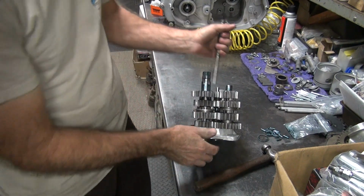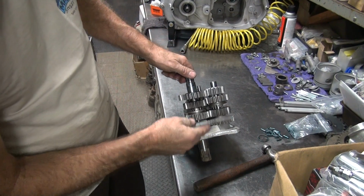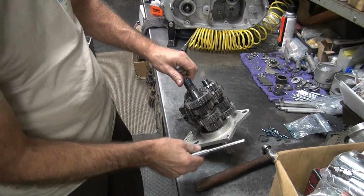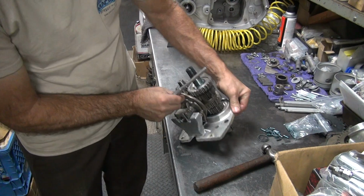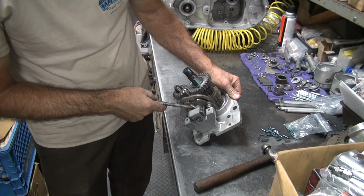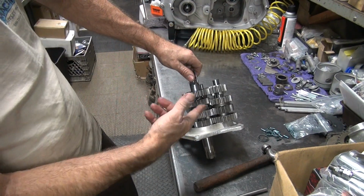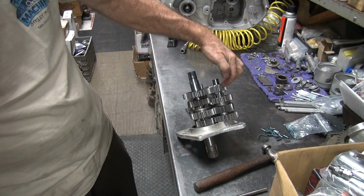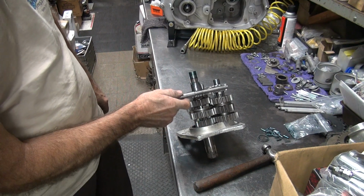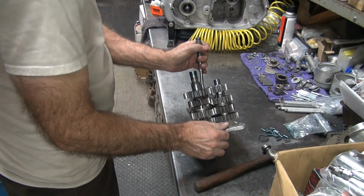Okay, let's go ahead and shift it. There's low gear. There's low. So you go over here shifting the mechanism over here, your dogs. This wheel here determines what things go. So there's a reverse, reverse, yeah. There's neutral, and there's second gear right there. You have to rotate things until they pop. You heard it pop, so you went from here to here. That's second. Because this is your second gear. You got first gear, second gear, third gear, fourth gear. That's how they work.